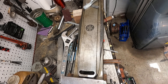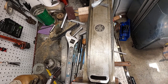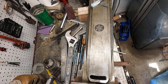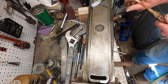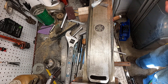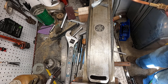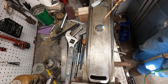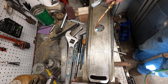Let's try not to burn the house down. I'm going to get the torch going here — get a striker, there we go. I'll get a little more hose length to work with. There we go. I want a fairly gentle flame here, just to crack that open. Got a nice little gentle flame going, and I'm going to heat this nut up gently.